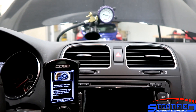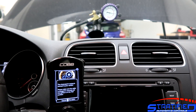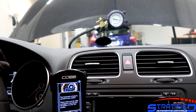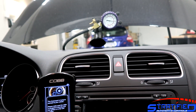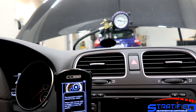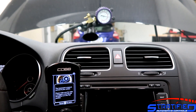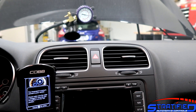Obviously this is not a permanent install — you don't want to be driving around with a fuel pressure gauge like this all the time — but it's good to do a quick test. You can take a video of your accessport showing gauges, or have a passenger video both the accessport and the fuel pressure gauge, and you can correlate where you're losing pressure, at what boost level, at what RPM, and so on. This will help troubleshoot what your low pressure side system is doing if the OEM ECU does not have that sensor in place.